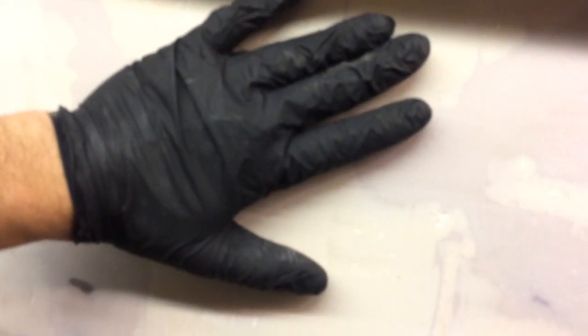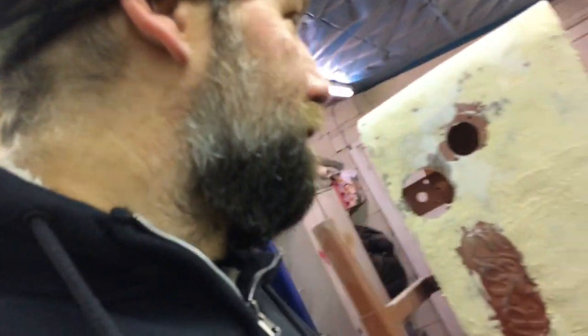So basically, what you do is you cut across into it, and it releases all the tension, and then you put it straight and spot weld it. Which is what I did here. You see, and then you have it flat for filling. You fill the top so it becomes flat like that.